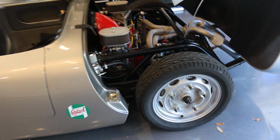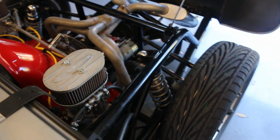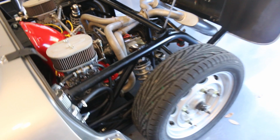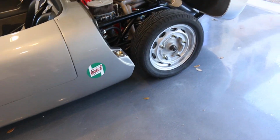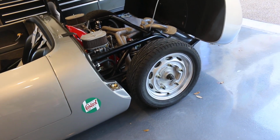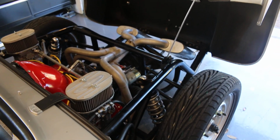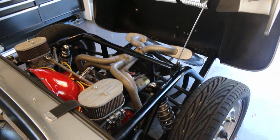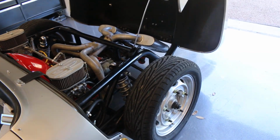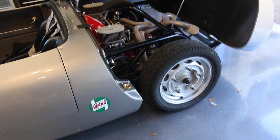But first of all, if you notice, it's an independent rear car. It's got Bilstein coilovers, and it's not a swing arm suspension. A lot of the early Becks are swing arms. A lot of the current Becks are swing arms. It's more expensive to make this way. It's definitely a premium feature. It's offered more and more today, that's true, but a brand new build with an independent rear and a Type 4 motor, and we'll get to that in a second, is a $65,000, $70,000 car.